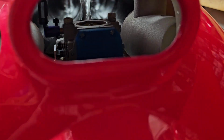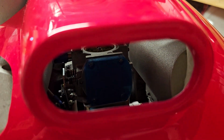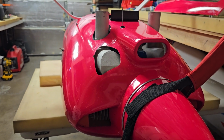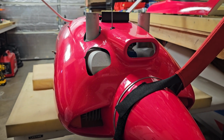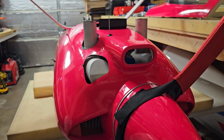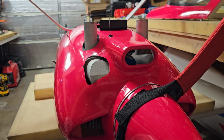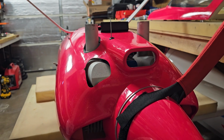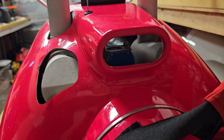That's why we have that cover over the atmospheric pressure. The GP has, and 3W has, the snorkel. And back in the day, we would just solder on, and still sometimes solder on, a brass nipple to the atmospheric pressure, and then run a fuel line into the interior of the plane. That way there wouldn't be any turbulent air bothering the atmospheric pressure.